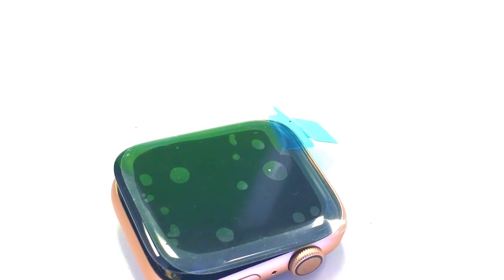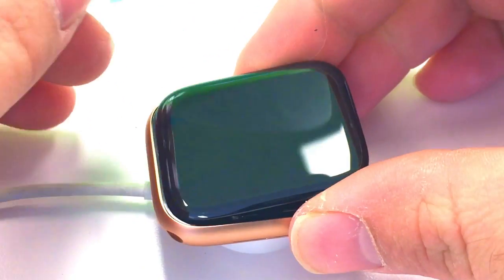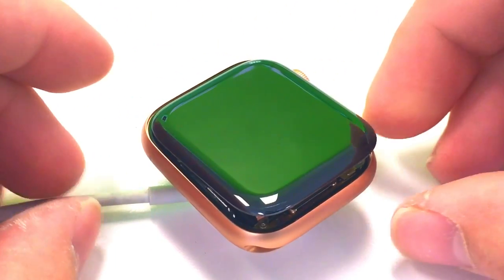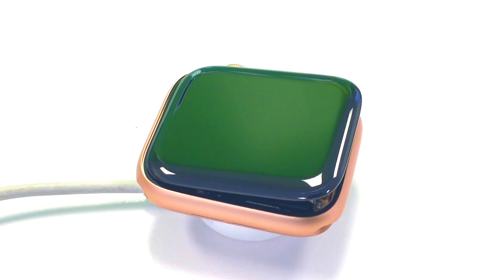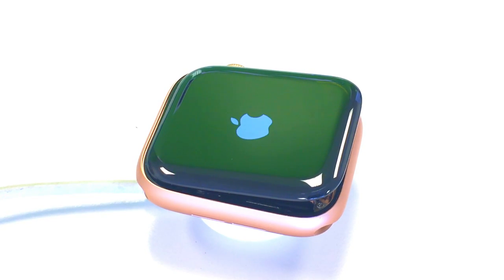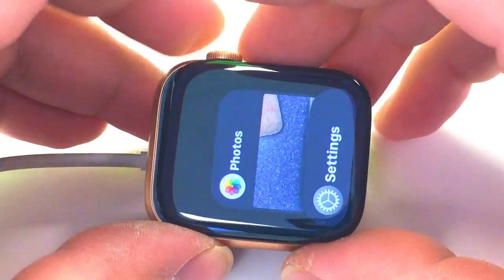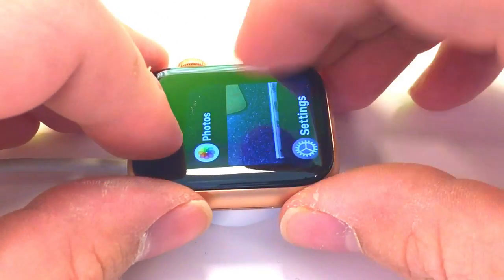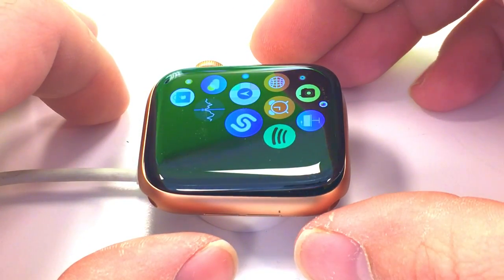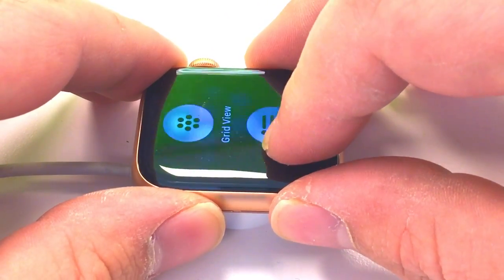We'll go ahead and turn it on. Looks like it died, so let's go ahead and plug it in. Give it a couple of minutes to charge up and take that protector off so you can see the screen — nice and shiny. After a minute here, it comes on. Let's go ahead and test the touch out, make sure everything's working, and also check the force touch. It's going to be easier to test the force touch while it's down and sealed, but as long as you line up the display in the frame you should be able to test it as well. There we go — as you can see the force touch is working.